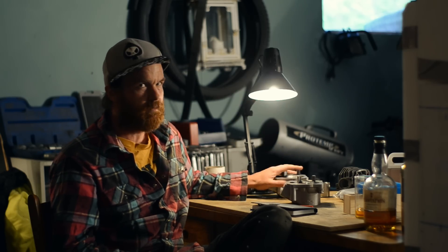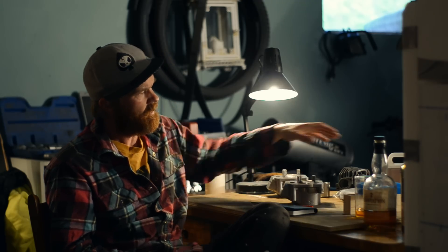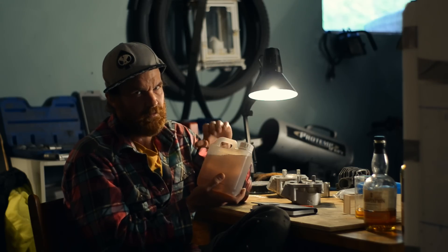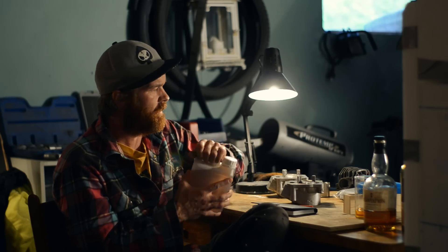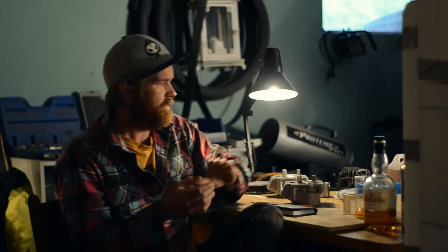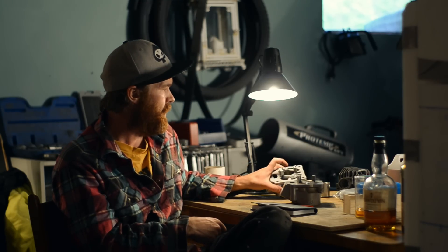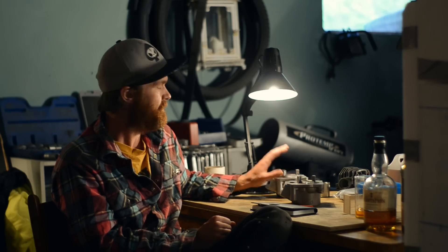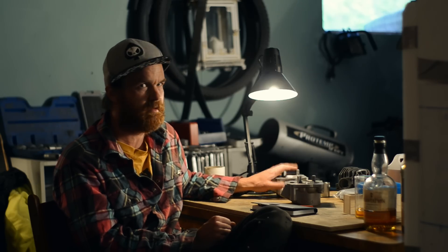To do that, I will have to strip what's been plated on — the old coat. And luckily, I've obtained two liters of this definitely-not-nitric-acid, which can dissolve the Nikasil coating. But I might try to just hone away until it's gone first, if it is a problem. It might not be — I should probably just try it and see what happens.